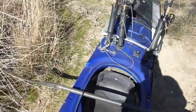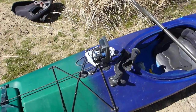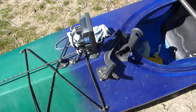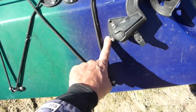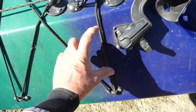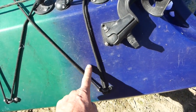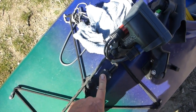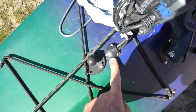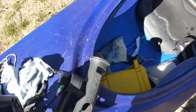I'll run through some of the details now and hope it helps people who are trying to set up sea kayaks to go fishing out of. I use a backing plate on everything, so when I have a bolt through the hole it's got to have a backing plate behind it, and this backing plate generally runs out about here. Backing plates run underneath everything. This mount obviously doesn't need a backing plate where the wires go through, but there's another smaller backing plate here and a larger backing plate there.